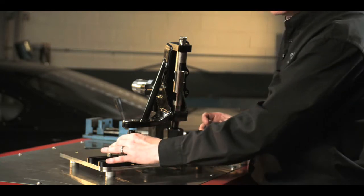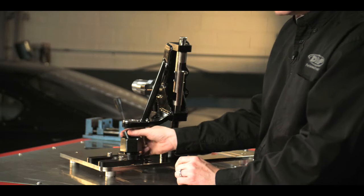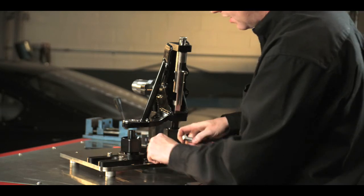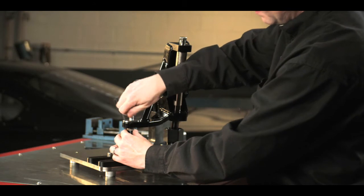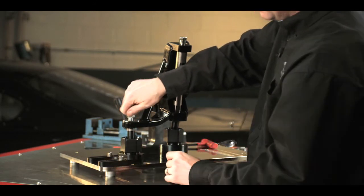At this point I can adjust my steering arm to its location. The steering arm ball joint will rotate 360 degrees for any angle steering arm. I'll leave that loose, use my spacer shims on top to come up to my steering arm height, lock my bolt down, and lock the ball joint down.